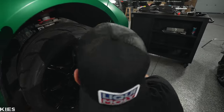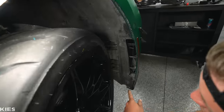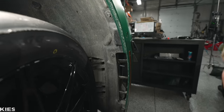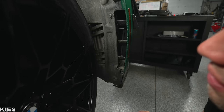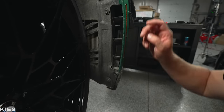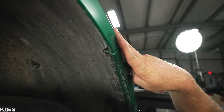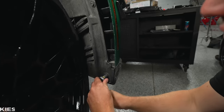The first part of the process is we need to release some of the fender liner. If you take a look in here, there's a 10 mil and there's a 10 mil. When I was working on Mike from Slow Speeds' G82 M4, his were 8 mil, so something to be aware of. There's actually one up here as well, so there's three of these — they're either going to be a 10 or an 8. And then up here there are two bolts, and I believe these ones are 8s as well, but we'll verify once we get there. So let's start by removing these.